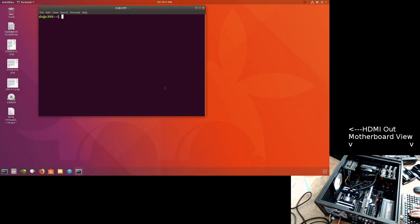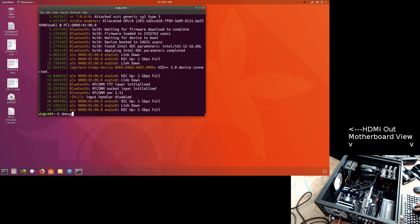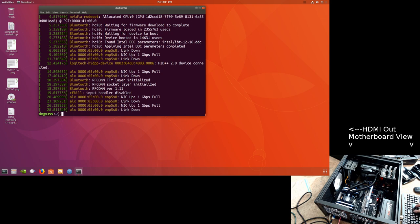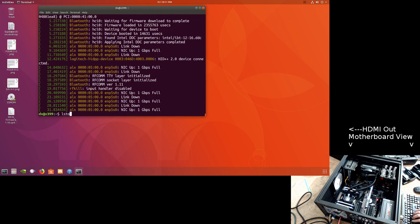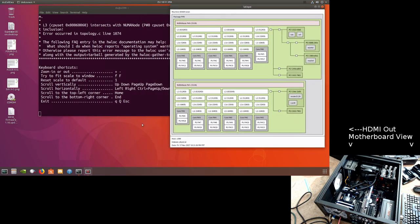Okay. The message. Looks like we're having gigabit network up down problems, which wasn't. That was topo. But now that I've got the memory intentionally set up, now it's recognizing 32 on one side and 32 on the other. Obviously, this has to do with the power management. It's an issue with the power management. This is stupid. Why does it keep on underclocking and having issues? Or underclocking, undervoltaging the memory. It's spec at 1.2 volts.